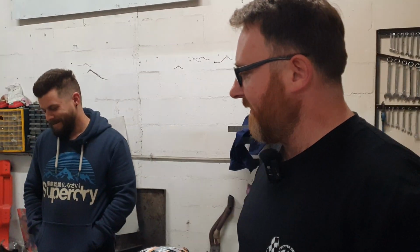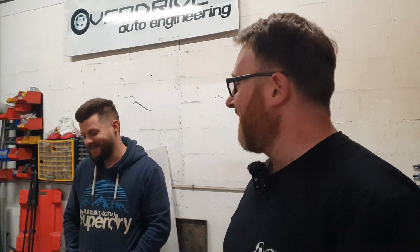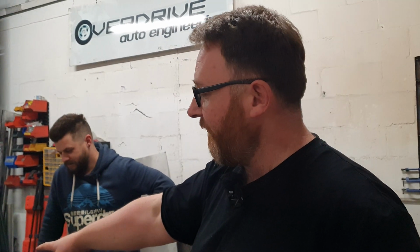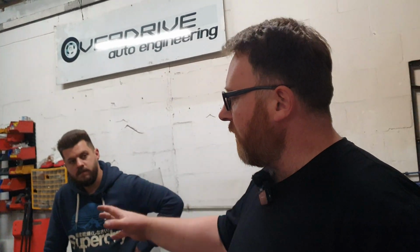So Captain Electronics here, back to the drawing board, and worked out that I wasn't getting a spark because those things weren't connected. There was actually no live going to any of them. Basically, I'd missed a few wires on making a switch live. So once we had that spark, we were like, that's interesting. So we then went down the path of trying to make the fuel happen, because once you get spark and fuel, then you'll have a running engine. But the fuel wouldn't work.